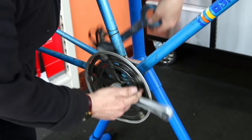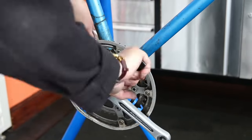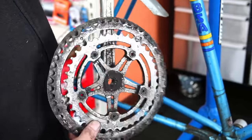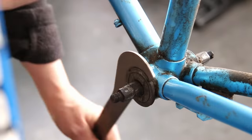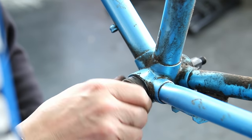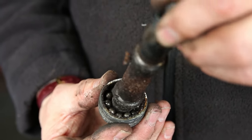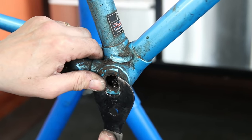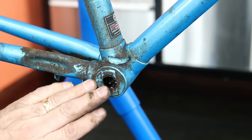I am a great fan of restorations that don't involve painting bikes. It's very easy to strip a bike down, clean off the old paint, repaint it, re-sticker it and call it a restoration. I actually love patinaed bikes — original paint, original parts, but everything working satisfactorily. You can see the way those bearings just fell out of that cup; there was no grease left in there, so it was running very, very dry and needed re-lubricating, but there was nothing wrong with the parts.